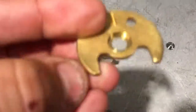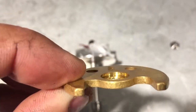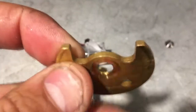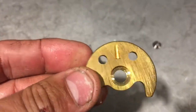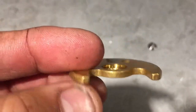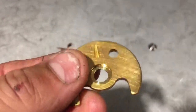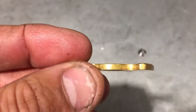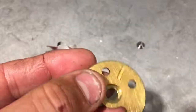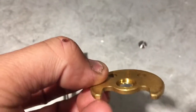Here's a good example of one. This is supposed to be flat — as you can see, it's worn almost all the way through. This is almost always caused on the M54 by a poorly working BOV setup or a DV setup that's just not set up properly. Either you have too tight of a spring, you have too small of a reference line, something that is causing the valve to react slowly when you lift off of the throttle.